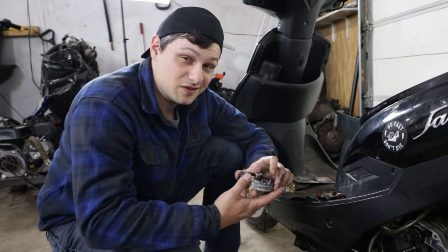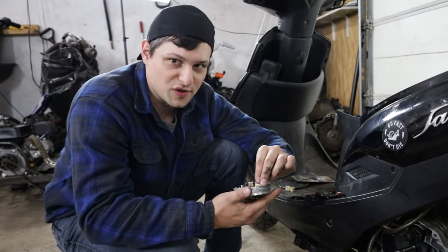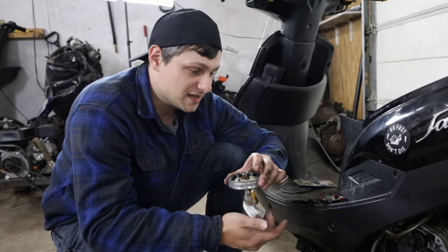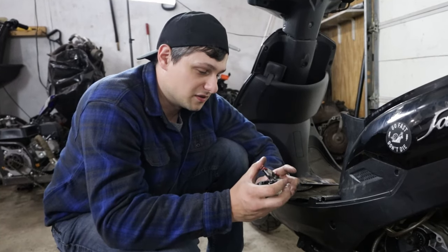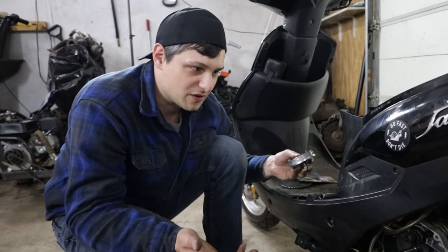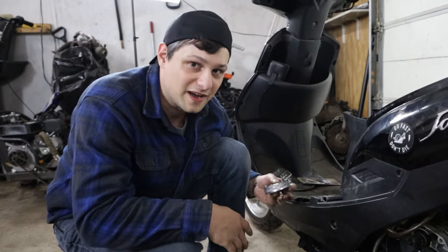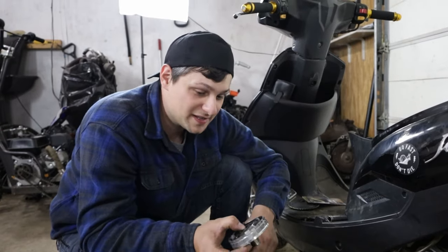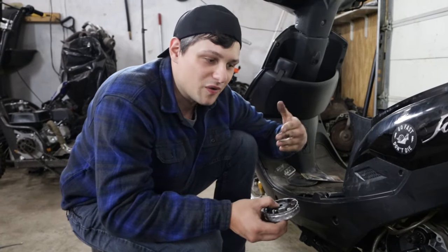These ones were $10 on Amazon, a little cheaper. There is a Dr. Pulley option — a lot of people go with the Dr. Pulley ones just because it's like the name brand for these slider weights. They're probably really high quality, but I'm assuming these are probably okay too and I don't know if you would notice a difference. What I did end up buying are five gram weights. I think that's going to help me with initial takeoff — a lower weight is going to help it rev faster sooner, so you take off quicker. Top speed without a big bore kit on a 50cc four stroke, you're going to be around 40 to 45 depending on how much you weigh. I'm 200 pounds so I'm probably not going to hit 45. I did hit 41 with the old weights. I bet I'll go a little bit slower with these, but it'll be more fun — it'll feel like there's more oomph in it on the low end.